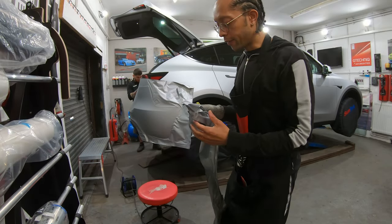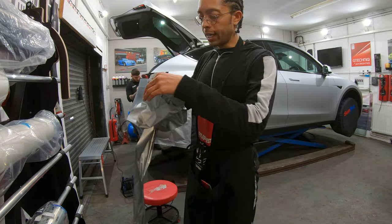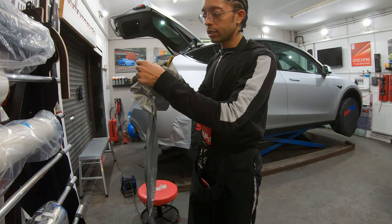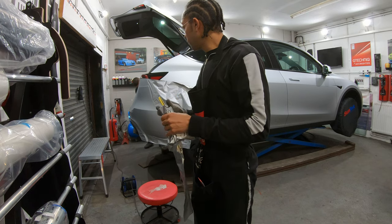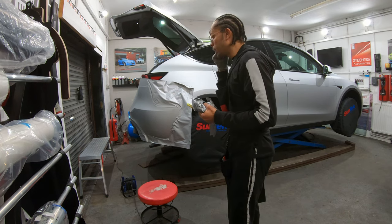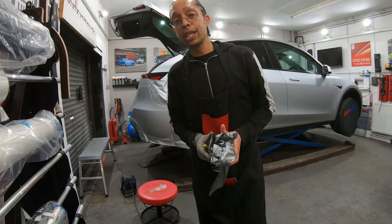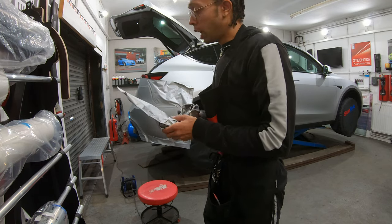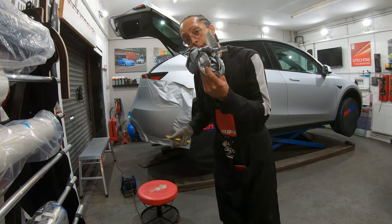Interesting fact about this Avery vinyl. It's satin metallic, and look at this. That easy, it wants to rip. So imagine pulling this around a panel, little tear. Very, very delicate film. One of the most delicate films I've worked with. So you can't be doing big pulls and big stretches with this. If you do, you lose the colour or it just snaps. So at this point, I've got no vinyl left because we've scrapped quite a few pieces trying to stretch it round panels. So we've moved to a different game plan. All right? Difficult.